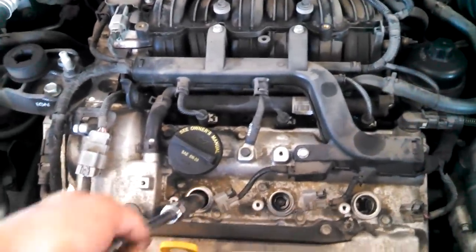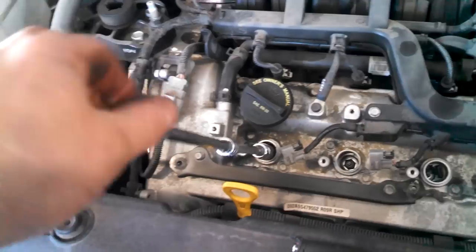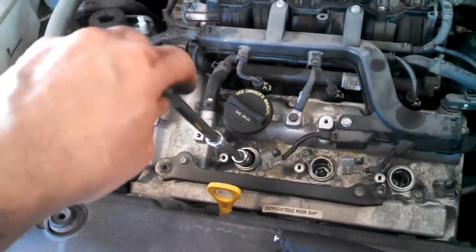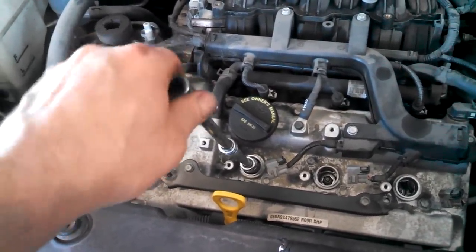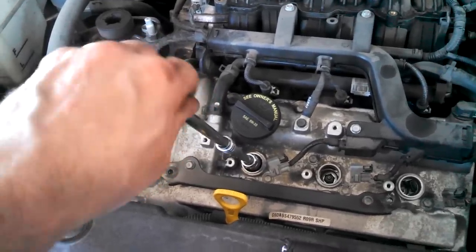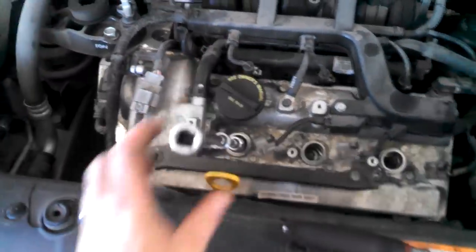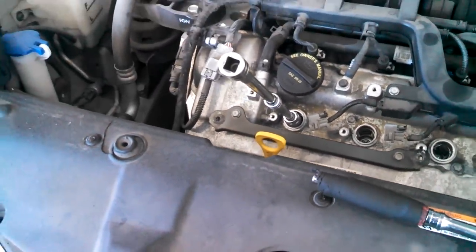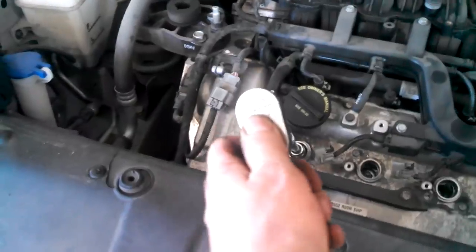So we got our spark plug on there. It looks like no one's dropped it. I'm gonna go ahead and put that in. Start all nuts and bolts and spark plugs, etc. Things that are threaded, start them by hand. So we've pretty much hit bottom, so that's where we're going to turn it 1/2 to 2/3 of a turn to install this spark plug.